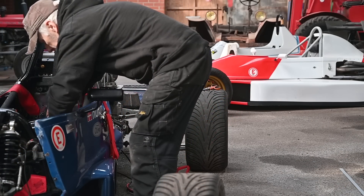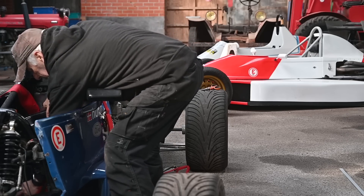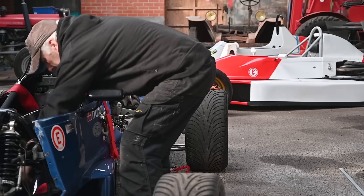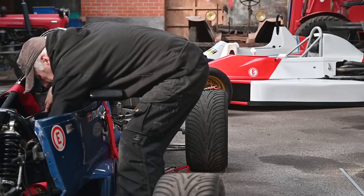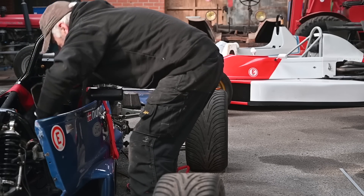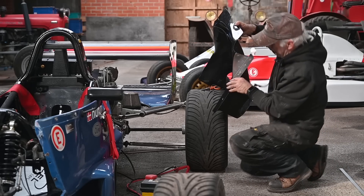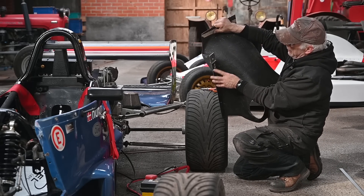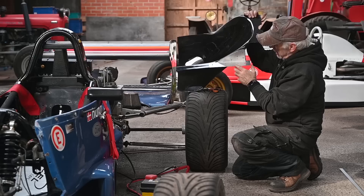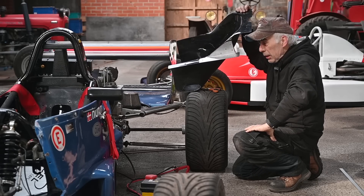Everything on this car is a very, very tight fit. I was just trying to fit the seat in and had to enforce it in a couple of places. The problem you always have with the seat is that the seat belts are in the way. As you can see, I've corrected the seat here — it wasn't long enough anymore because I slid the seat forward, so I had to install a piece of aluminum on it. Now I'm going to lock down those seat belts and then install the seat.